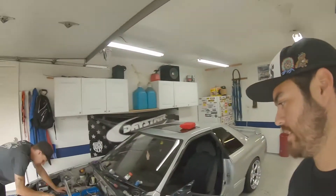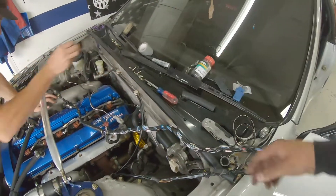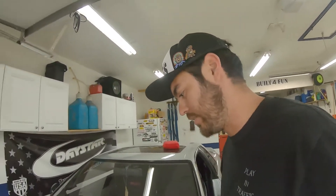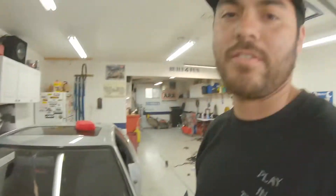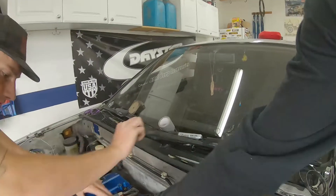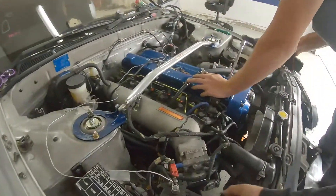New day — day three or something of wiring. We went through and actually pulled the whole harness again, unloomed all of it, pulled out the wires we didn't need, found a couple we did need to connect. I didn't film any of it because wiring is boring to watch. We put it all back in and still weren't getting spark. Checked this plug — it wasn't getting 12 volts. As a temporary fix, I spliced into it here and ran that wire straight to the battery. Now we actually have spark. We know we had fuel, we know we have spark, and we have a MAF that reads something. Still got fabrication to do on the intercooler piping, but just to see if she'll fire up — I think she'll start. Moment of truth. The GoPro lost the audio on our first start.